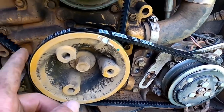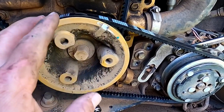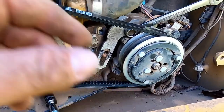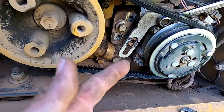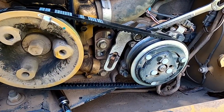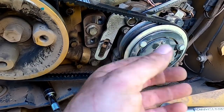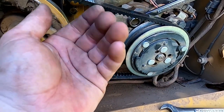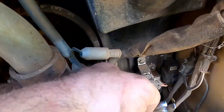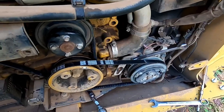I even thought about cheating and sliding the belt on, but there was no way — I couldn't turn things and work it on like that because of the engine, and I didn't want to mess with the compressor clutch. So I took the bracket off. There's a bracket right there for the cover. I just wanted to show you how I was able to get the compressor to move up enough for the belt to go on. You've got your AC lines right there and there — they move with the component, so I didn't mess anything up.